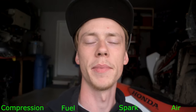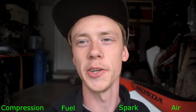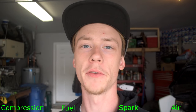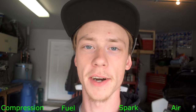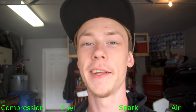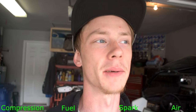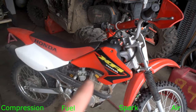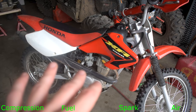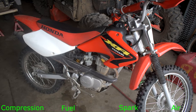In the meantime, if you're at the place looking at a bike to buy or you just want to see if your bike will fire up, there's a little trick you can do to get your bike started quickly. If you think fuel is the culprit, get a small bottle, poke a hole in the top, fill it with some fuel, and spray that fuel into the air filter itself. When you kick it over it'll suck the air and fuel mixture through the air filter and hopefully start the bike. That's the exact trick I used to get my XR100 started — I bought it as a non-running bike for way cheaper than they normally go for, and all it was was a dirty fuel system. Now it runs like a champ and starts first kick every time.